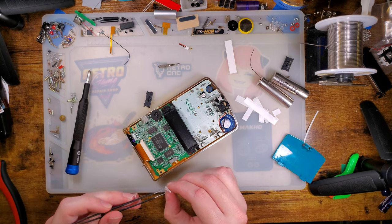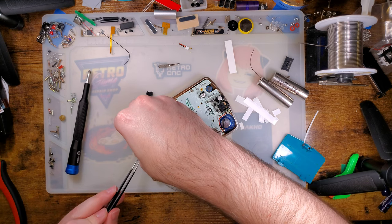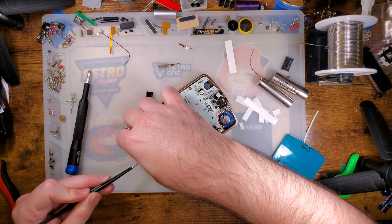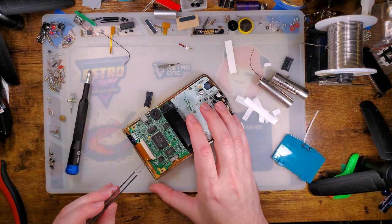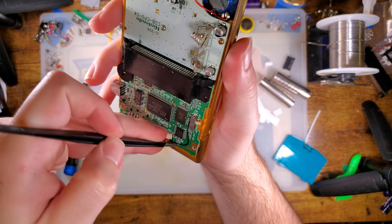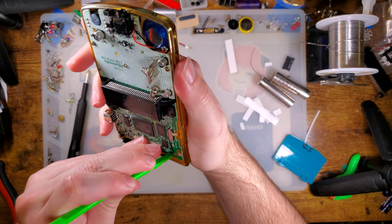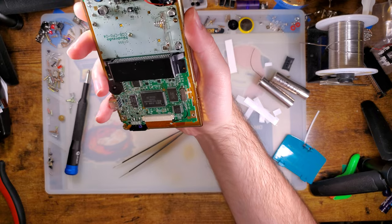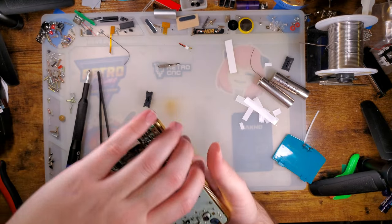I wonder how well this is going to work on this electroplated shell. Pin that up. These things work significantly better when actually stuck down to the shell. Got a little bit of double-sided tape on it, and then I'm just gonna jam it up against the plastic right there. Just remember that's stuck down if you ever take this thing apart, because otherwise that's getting ripped off. I think alternatively, you can just kind of flex it around and then the pressure from the ribbon should hold it into place, but I wouldn't rely on that.